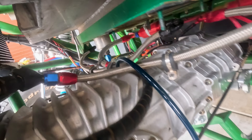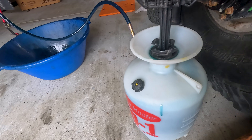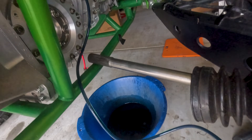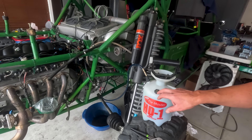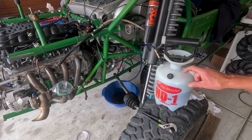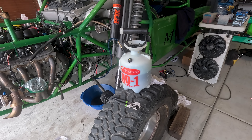If I had an air chuck plugged into this, we could just run it and walk away. I've got about six quarts of oil in here. What I'll do is drill a hole in here and put an air chuck at 5 psi — maybe 10. It does have a pressure relief valve; if you're putting too much pressure in, it'll pop the valve so you can play with that. This will make a nice servicing tool for transmission fluid, rear differential fluid, motorhomes, trucks, etc.